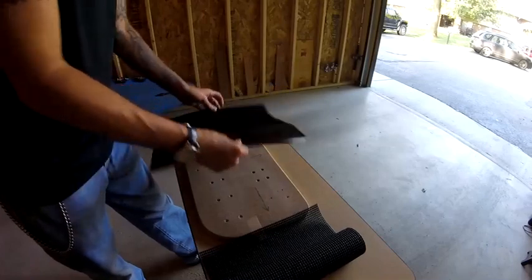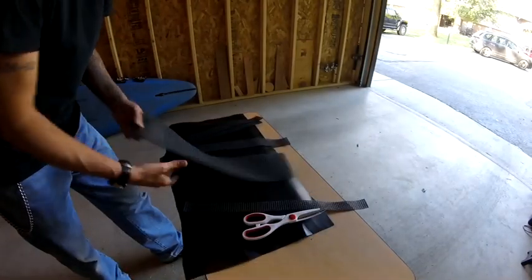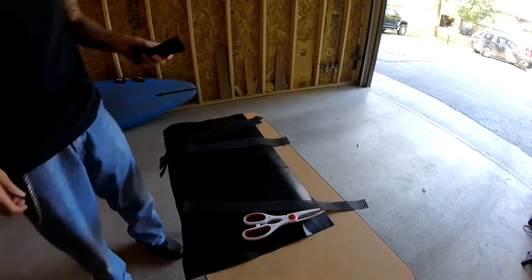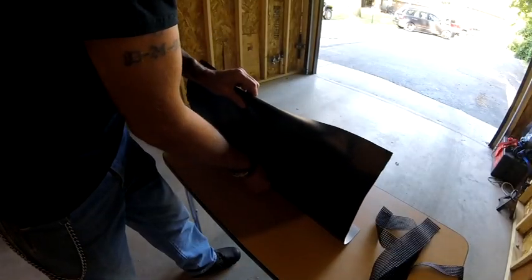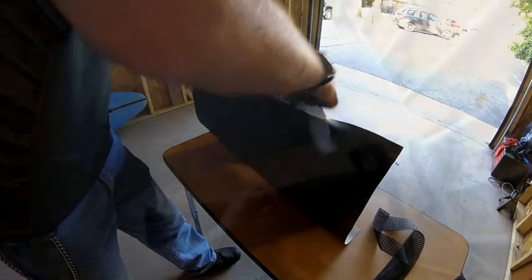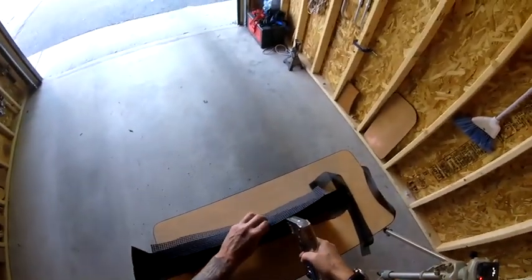At this point, I'm ready to cover the insert with vinyl. I'm also going to use this grip liner around the outer edges as a little extra hold and protection for my trunk. Now that everything's cut out, I'm ready to start stapling the edges. All I'm doing is folding the vinyl over the edge and laying the grip liner over the top. I'm using five-sixteenths and eight-millimeter staples to staple it on the outer edges.